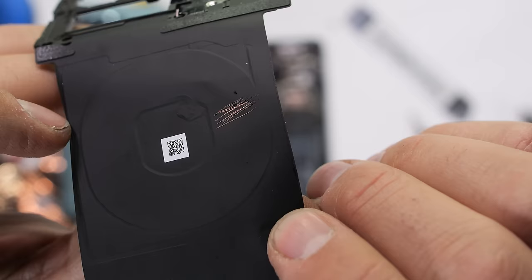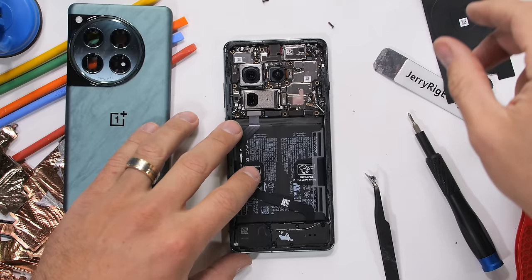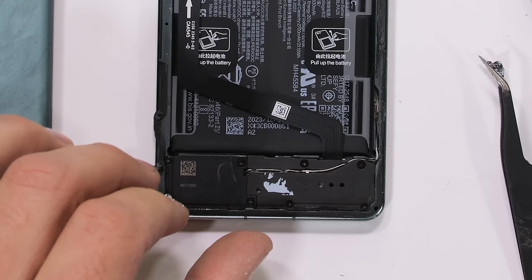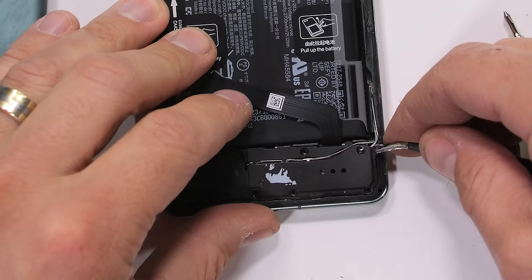But with the help of the dual cryo velocity cooling system, it can pack a punch. With the battery ribbon unplugged like a little Lego, I can move my way down to the bottom plastics. These have 8 more Phillips head screws. With the screws gone, the lower stereo spatial audio speaker can be removed.